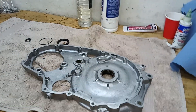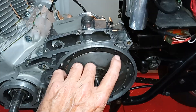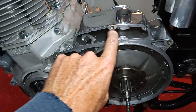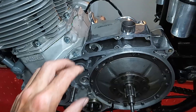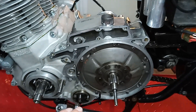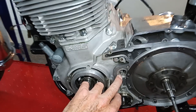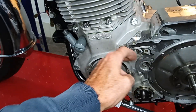The breather comes out that little hole into this triangular section, and then there's another hole here which goes through the breather housing - that'll have a casing on later and is all part of the engine breather system. This is where the second oil seal goes for the cross shaft, and we just want to seal it so it doesn't leak out.